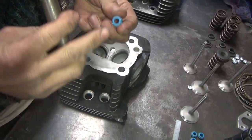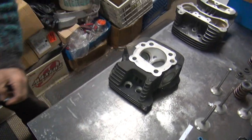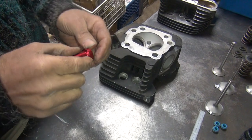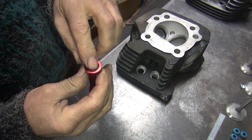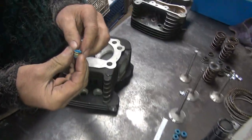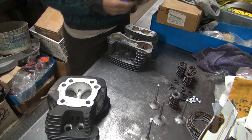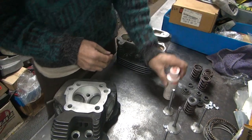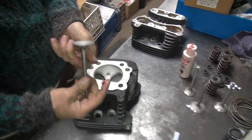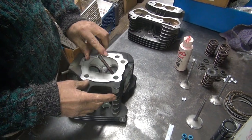Now that's the stock driver, but this is not a stock seal — see it doesn't fit in there very well. So this is a non-stock driver that's been modified. It does fit in there alright. See it had the clearance to clear the seal. Hopefully it doesn't have interference when we put the valve through it because it expands it out. You've got to be careful about beating these too hard — the guide swells the seal bigger and it doesn't do anything. Then you get to throw it away and get another one. Somebody marked them — it's nice when that happens.